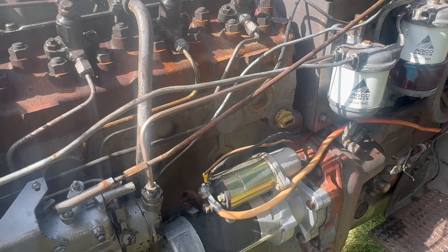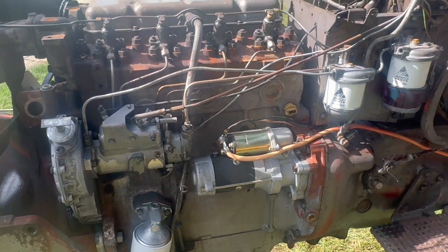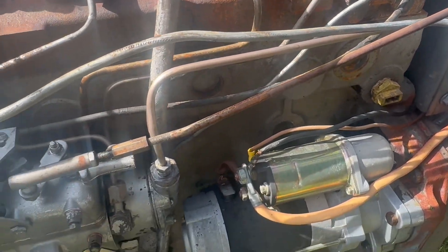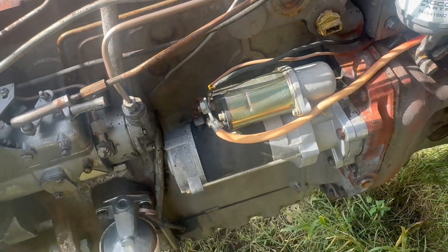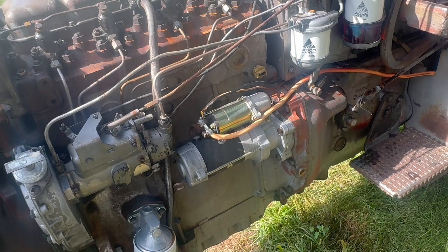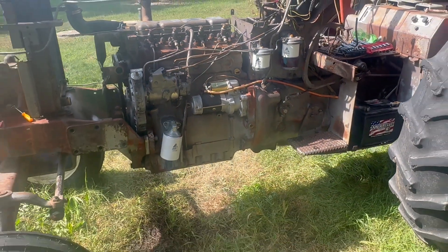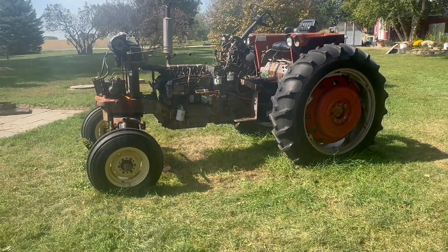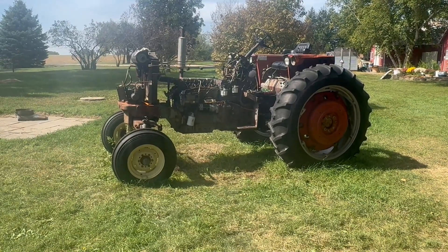That's a little bit of work, but I got a little bit OCD and I think the end result is worth it. Just my opinion, but thought I'd show you how I do these lines. That is a good fuel line and it didn't cost me hardly anything. I had the quarter-inch brake line on hand and used the fittings — the only thing I had to buy was those rubber washers and those were like 10 bucks for a 10 or 12 pack. Not too hard, just got to take time and do it. That'll probably wrap it up for this video. Thanks for watching, I hope I helped somebody out. That's what I'm trying to do these videos for — it seems not too many people do what I do anymore, so just trying to help.